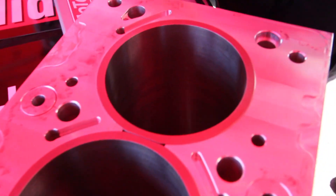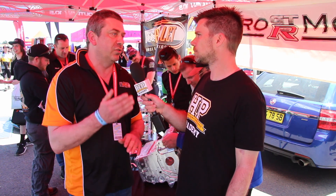Also, the deck is three-quarters of an inch or 19 millimetres thick. A lot of people would probably assume that a factory cast iron block is nice and stiff and strong, but when you're starting to get up to 1100, 1200 horsepower, that deck surface of the factory block is starting to move around. Yeah, so a lot of people you hear talking about the head gasket failing or the engine failing because the head has lifted — that's not actually what's happening. What's happening is that the surface of the head and the surface of the deck are not remaining flat.